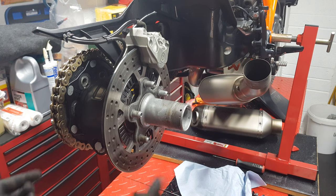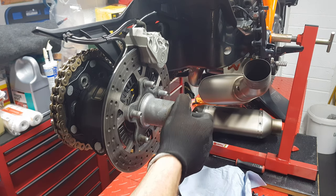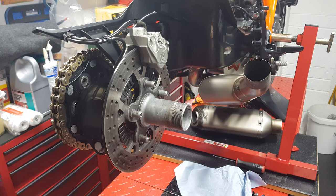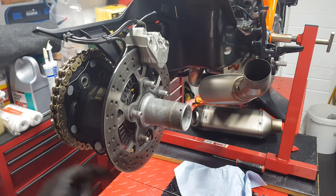With the rear wheel removed, if your bearings are quite bad you can rock it from side to side — if it's stupidly bad you'll see play in it. This is the Gen 1 1290 Super Duke. I believe the bearings are a bit of an issue on the Gen 2 as well. On the Gen 1 they haven't put a drain hole in the bottom. This one's got nearly 27,000 miles on it, ridden in all types of conditions, so I don't know what it's going to be like inside.